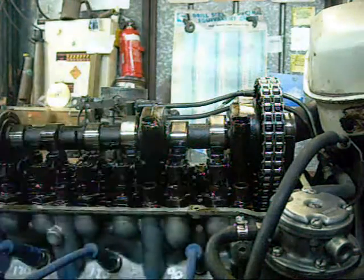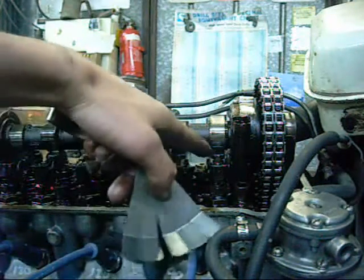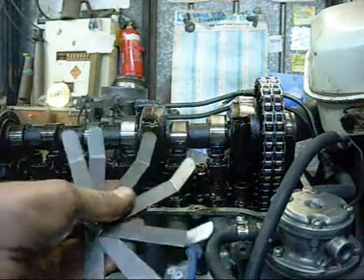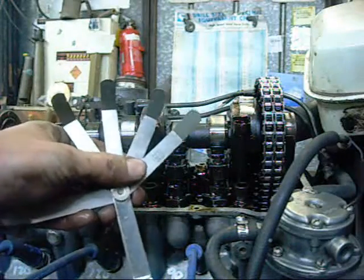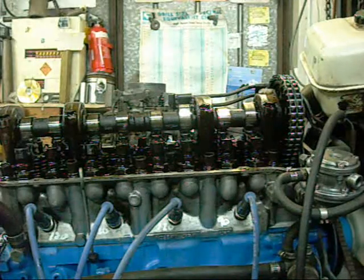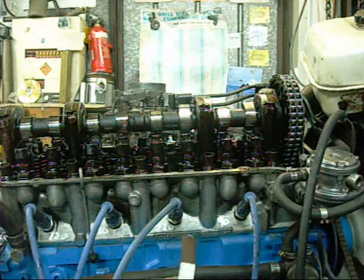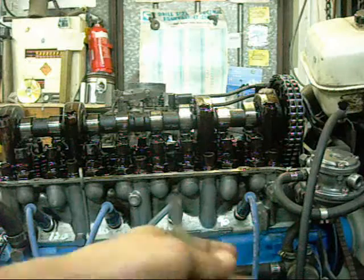The valve adjustment is pretty much the same — we have to slacken off that nut there and then wind the post down so that this rocker has a bit of clearance. I've already played with this one so it's a little bit loose, but let's look at some gauges. These are the Repco brand gauges, the old cheapos, about $15. They don't have exactly the right one for this job — I want a 0.35. The Repco gauges; closest one to what I want is 0.381, which is slightly larger than what Brad recommended, but it wouldn't hurt.